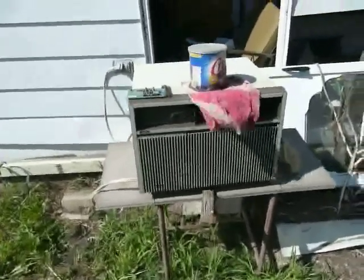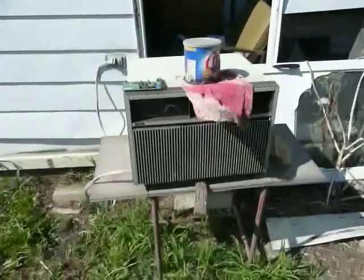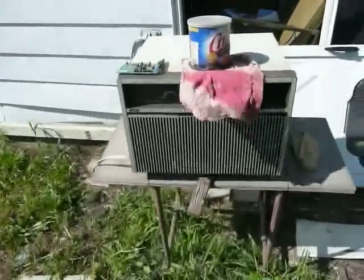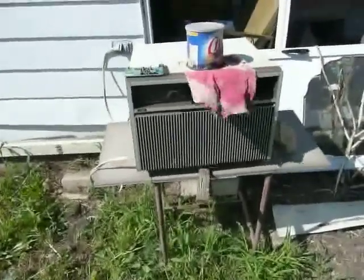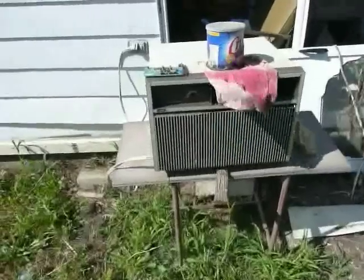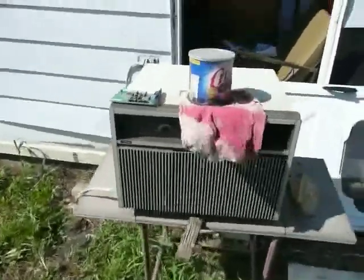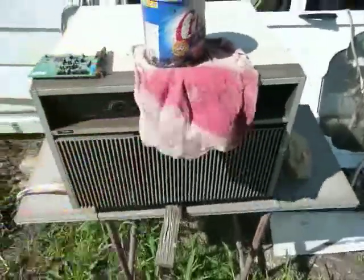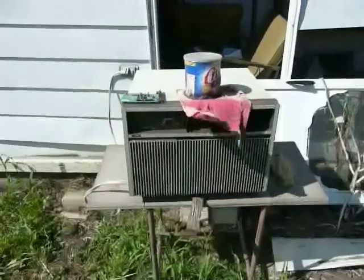So I took the thermostat completely out of the circuit since the contacts were hopelessly burned, and I just didn't feel that there was a great need to replace it. If I need to cycle this unit, then I have a heavy indoor-outdoor timer that I can plug it into for that very purpose. So now the compressor has just been hot-wired to run whenever the unit does. And at the same time, that has solved the fan motor problem. The fan now runs correctly on all 3 speeds that it has.